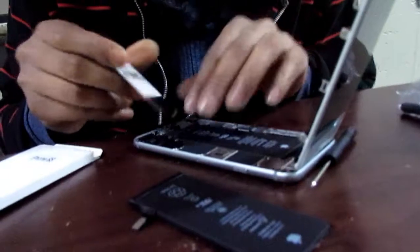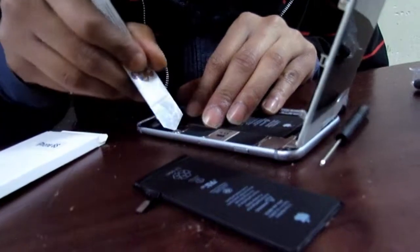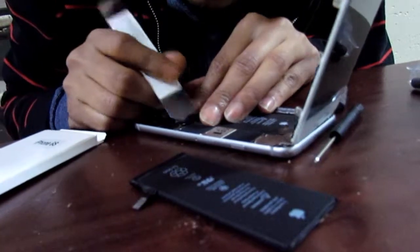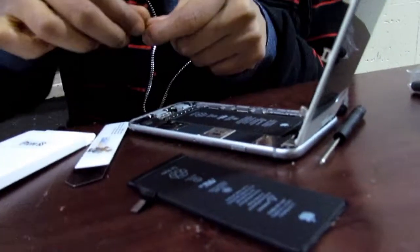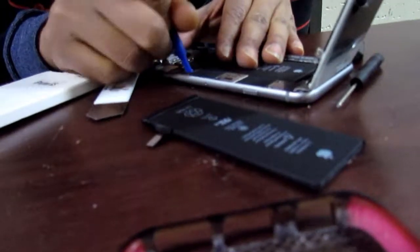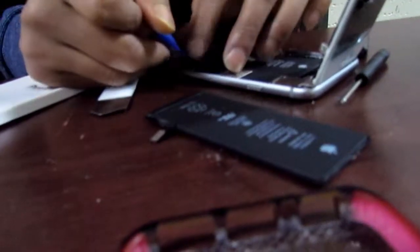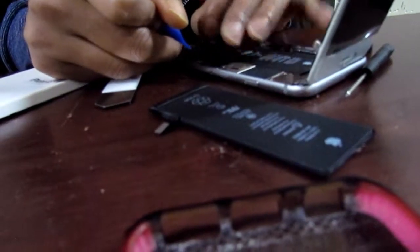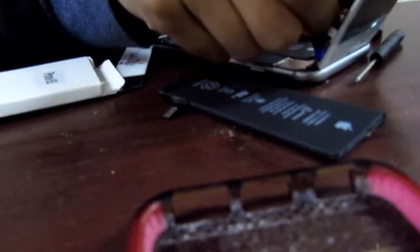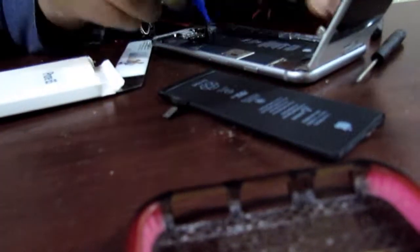After that, you can use something like this to get under the shield. We got under the shield — now we take the shield off. Next thing we do is use a plastic prying tool to lift off the connector. Here is the battery connector and we got it off. Now the battery is actually held in there with some adhesive — which is glue, in other words. So what we're gonna do is find a spot where we can stick in our plastic tool and give it a little wiggle so we can get under it.